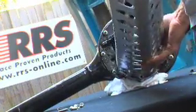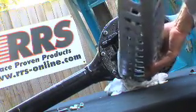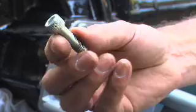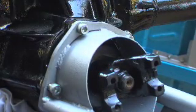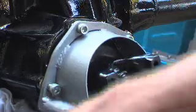Now it's time to 3-link this 9-inch. Remove the original pinion housing bolts and mount the torque arm using the 3/8 cap screws supplied. You'll need to use cap screws because there's some tight spots on the underside. Tighten them all up to 32 foot-pounds.